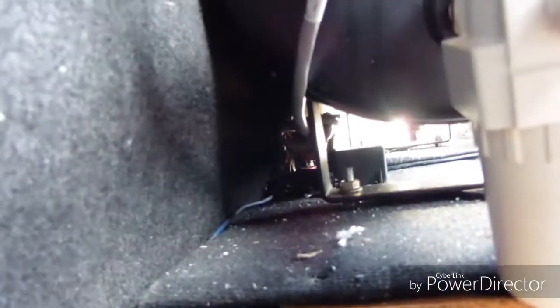That's my pressure. This cable right here, follow it. It goes all the way. It's melted to my power cable. That's why when I pull the tank towards me, it's good. I don't know how well you guys can see. I can barely see. I'm trying to look into the camera. All right, it is melted together, those two cables, which is a huge fire hazard.